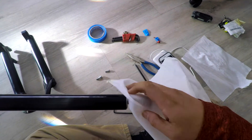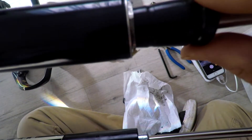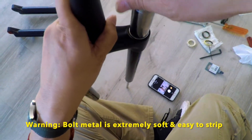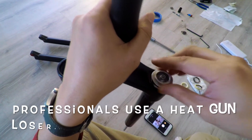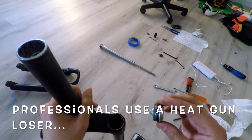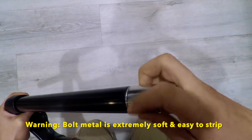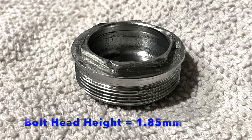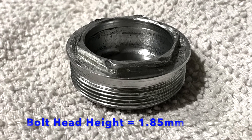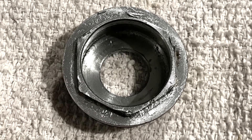Moving to the air spring side, this is the rubber stopper — we're going to remove it. You can see it's tapered on one end so that it fits into the end cap of the stanchion. Same warning as before about the soft metal — make sure you use the socket. I also used the stove for this side since they were really stuck; heat it up, loosen things up a bit, and they come loose rather easily. The bolt head height is about 1.85 millimeters which is really short — combined with the soft metal you can really mar it up, so again, socket recommended.